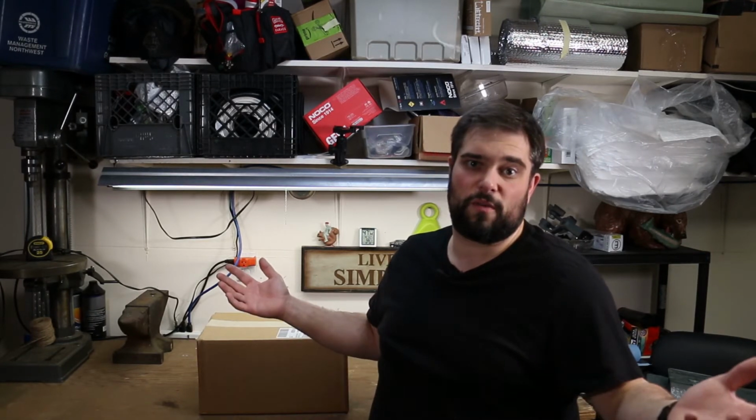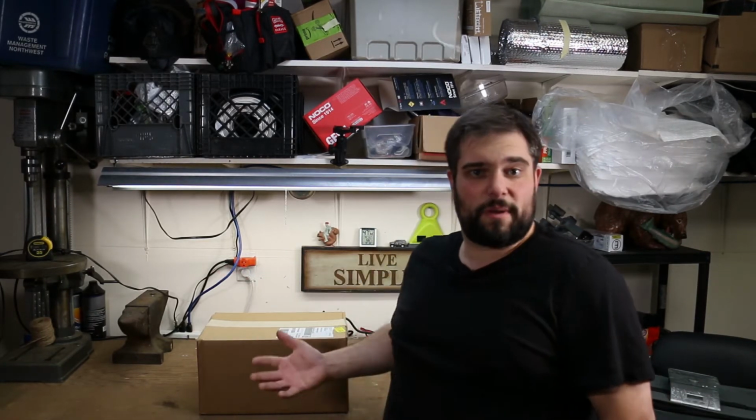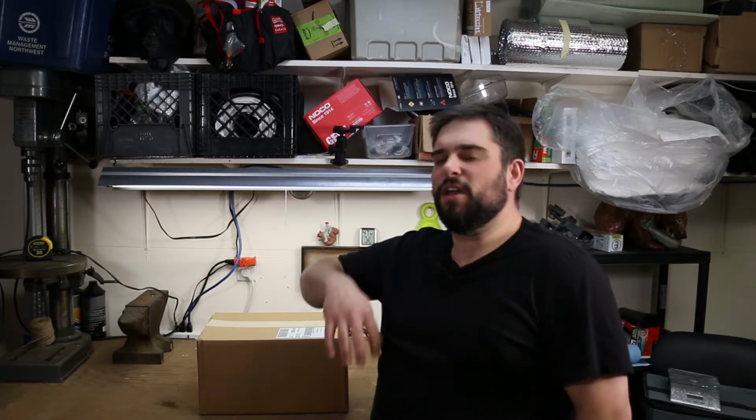Well, the saga of figuring out my issues with my backup auxiliary battery system continues. I gave customer service over at Redarc a call over in Australia. You got to time it right depending on what time of day you are in the US or wherever you are in the world. They walked me through all the troubleshooting steps just to make sure that my alternator was putting out the right power and that the Redarc was receiving the right power and putting it out to the Battleborn battery that I have correctly.